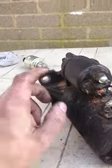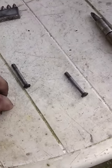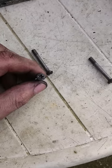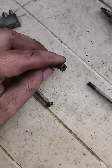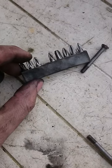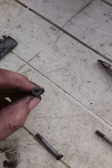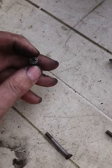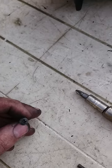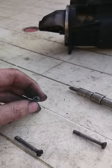Mine was held on — this solenoid is held on with three screws. Really important: these are normally done up quite tight and these have got a Phillips head. There are loads of different Phillips profiles, so don't just get any old screwdriver. Try some different screwdrivers until you get a really good fit so that when you give it some real pressure, it's not going to twist the head up.